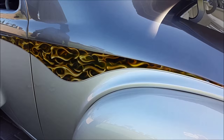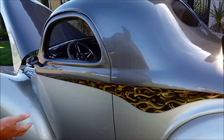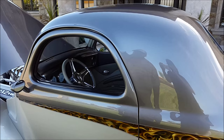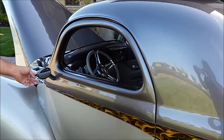The ladies seem to love the car as much as the guys do, which makes it kind of fun. You'll notice the body lines have been cut, we've chopped the top four inches, reversed the doors to suicide doors, shaved the doors, put power windows — it's got proximity start, remote, no handles. It's got side mirrors with turn signals in them, just as you'd see on any late model car.